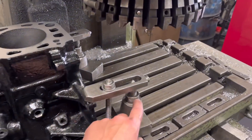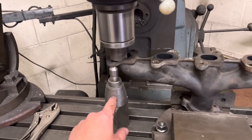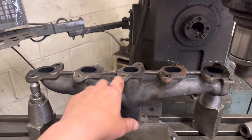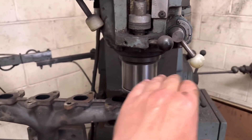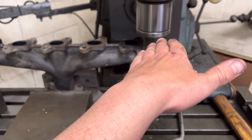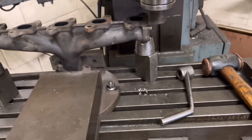I've just had to wait because I'm using all these posts on this block — I've just had to wait until I finished that to finish off setting up the banana manifold. Because it bows like that, I just touch it on in the middle once I've got the height either end about right, touch it on the middle, make sure it's on zero down here, make sure that the head's locked off so it can't fall down, and then bring it over to the right.